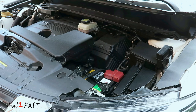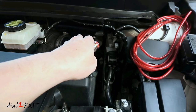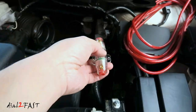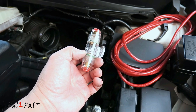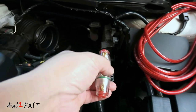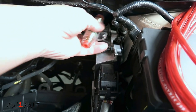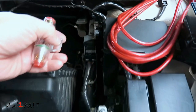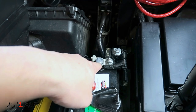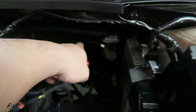With this install, I'll need to install an amplifier in the vehicle, and the amplifier will require a dedicated power cable running from the car battery into the vehicle and directly connecting to the amplifier. That power cable will also need an inline fuse to protect it from any short circuits. I'm thinking of removing this nut right here, making a small bracket, and mounting the inline fuse in this location. The wire will come from the battery post to the inline fuse and then out through the firewall.